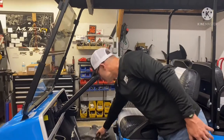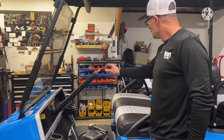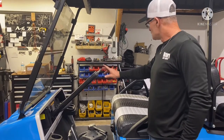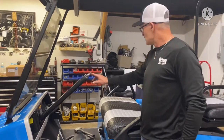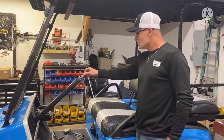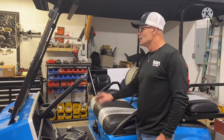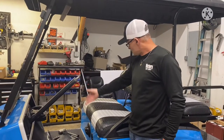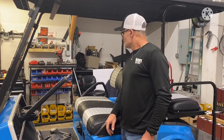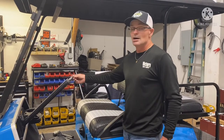Sometimes it's aggravating, and as you can see, I did have to whack it a few more times than what I wanted to, but you want to really take care of these threads here. So make sure when you thread your nut back on there that you thread it just to the top of that or a little bit beyond it, because you're going to be whacking on it really hard. So that's how I get them off. Everybody uses different ways of doing it, but that thing's probably been on there since 2007 when the car was made. So anyway, hopefully that helps somebody to be able to pull their steering wheel off.